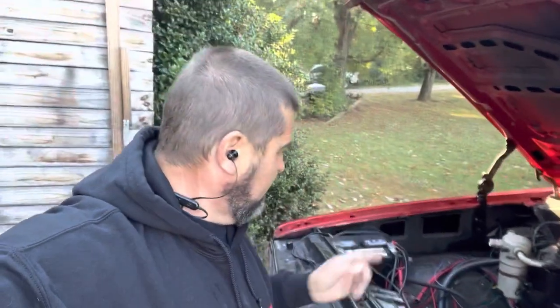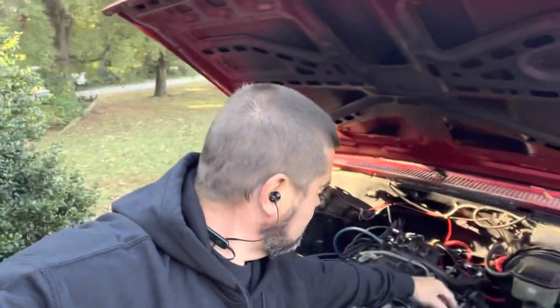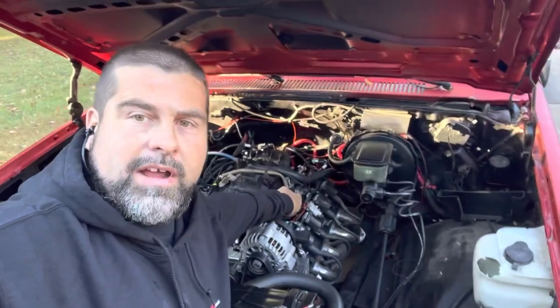The fuel pump is clearly in the wrong location — it's right here from the fender well. These are pusher pumps, not sucker pumps. That's not what they're designed to do. And you have a myriad of issues with it. This FPR, which is factory, should have the fuel pressure at around 58-ish PSI. Somewhere in that neighborhood, 56 to 60 would be what that regulator should show.